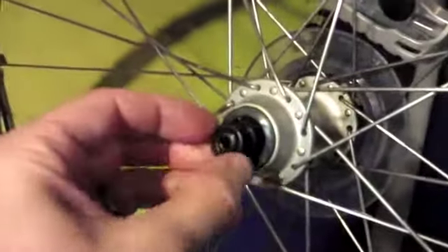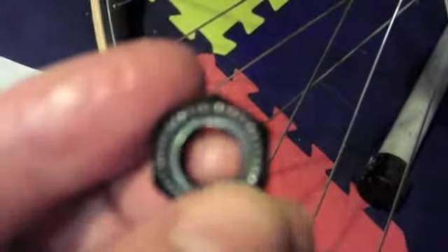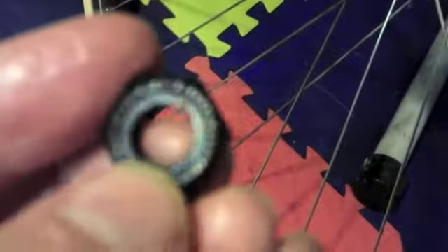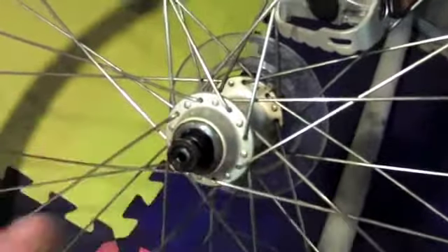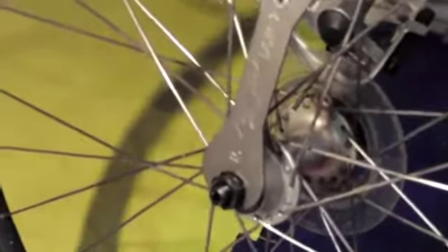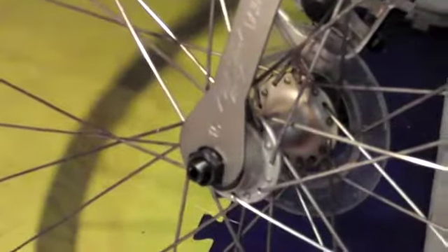What you've got now is the washer, which goes on first, and then the lock nut. Notice this nut — on this side it's got ridges, and on this side it's smooth. The smooth side goes against the washer. The ridged side is for clamping onto the frame of the bike to keep it from slipping — the quick release squeezes in there and holds it in place. So put that on and make sure it's tightened. The cone was screwed on, the lock nut is on and tight. You take your cone wrench and a 17mm wrench and tighten them together to keep it from slipping.